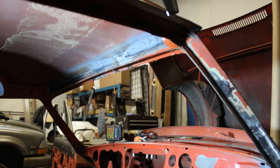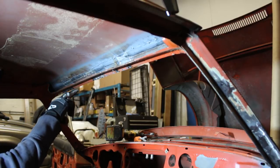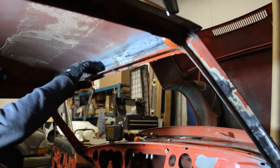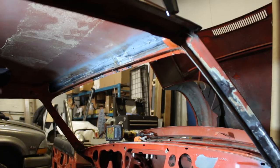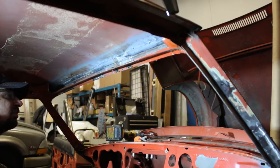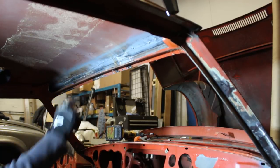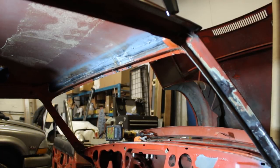That looks beautiful now. Do you see it from there? What I did is actually I just seamed the top and the bottom pieces together, and that gave me enough strength here to fill it up with weld. So you know what, guys? I think I might do that all over, even here where the new pieces are, just so I don't let water coming in.